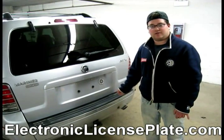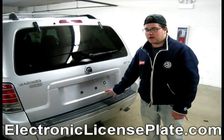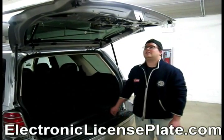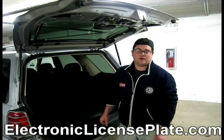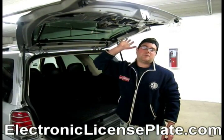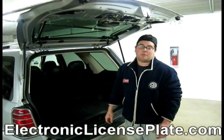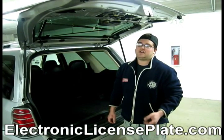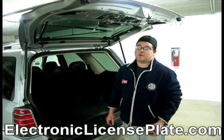First thing you have to do is remove your license plate and license plate bracket from the car so it looks bare, just like this. Okay, for this automobile, I am looking for the brake power and the brake ground for the brake lights. In this instance, I had to remove the panel, which was very easy, 4 screws. Most cars you don't need to remove any panel. This is a very easy install. You have to locate the power and the ground for the brake light as step number 2.